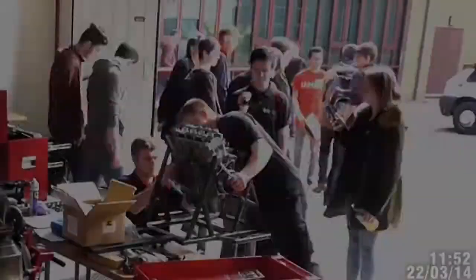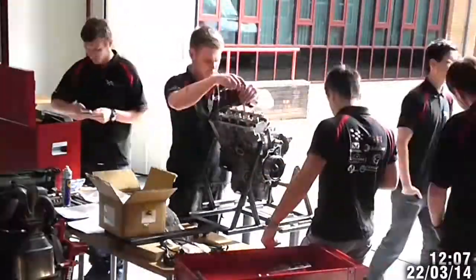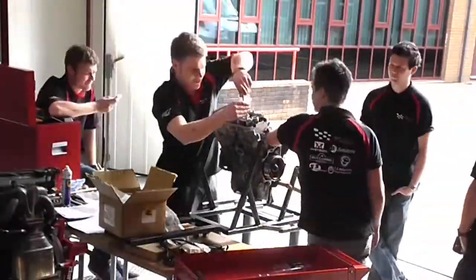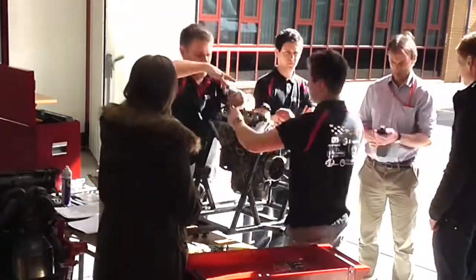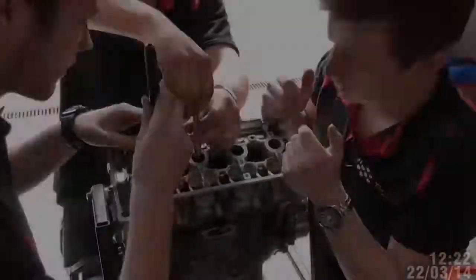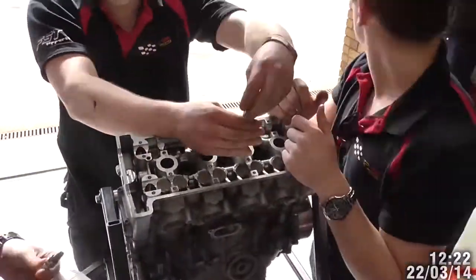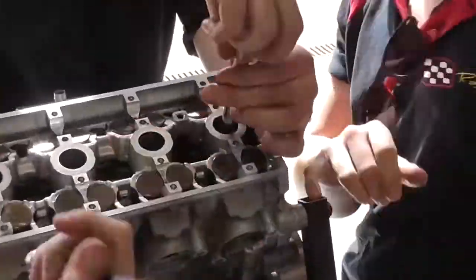We rotated the crankshaft of the engine to make sure that the valve train was in time. This was unfortunately not the case and was something that had been done before we took possession of the engine. We then realised that we needed to completely strip the top half of the engine down and make sure no damage had been done to any of the valves and the pistons.